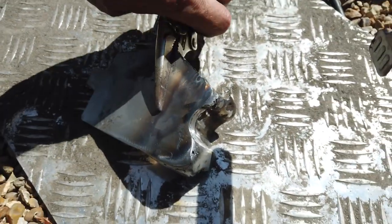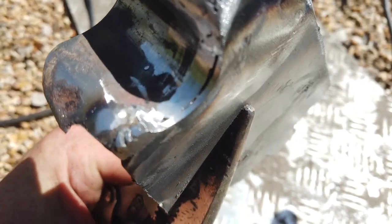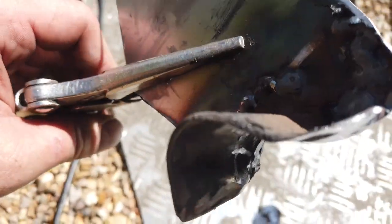We've managed to graft that piece - there was enough of it. That's the inner part of the section and that's where it guides the jack when you jack your wheel up - it slots through there and guides it into the chassis leg. That was still pretty much intact until it met the bottom of this piece that we've made. I've pulled it with weld inside the back - there's a pool there, nicely gathered around. I got a nice build-up of weld glowing.